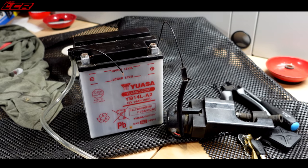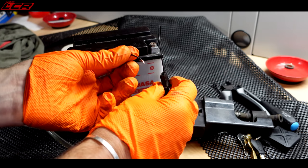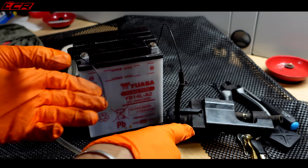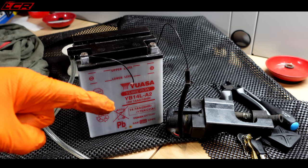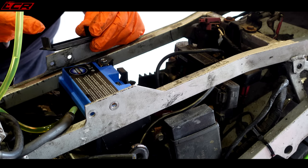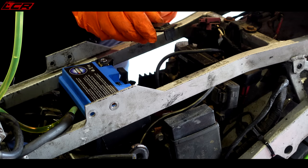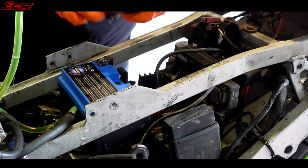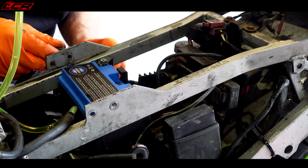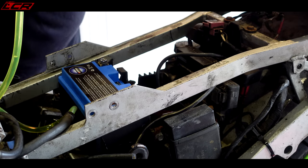Just to prove the point - I've rigged up a couple of bits of wire from the old battery terminals to plug directly into the pump and the pump does work. The fuel pump is operational. Got to work out why it's not working on the bike now. It's time to check the fuses I think. We've got a fan - that'll be for the radiator fan - tail lights, headlights. So there's nothing in there for the fuel pump. None of those fuses have anything to do with the fuel pump. Could be faulty wiring, could be dirty connectors even. Electrical contact cleaner - let's see if that helps as a starting point.